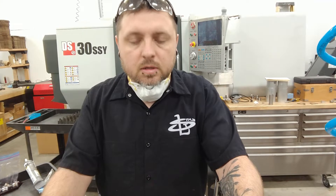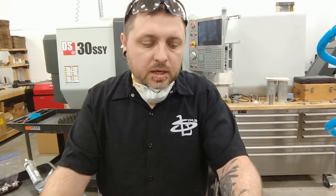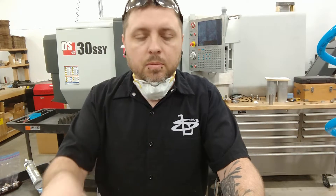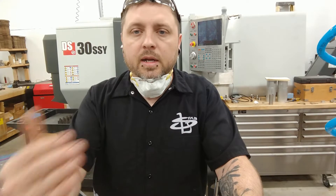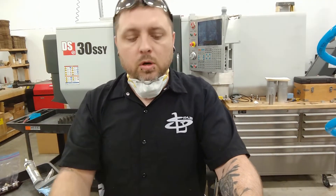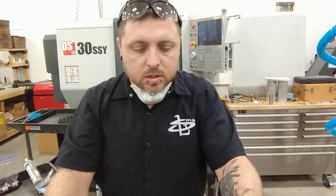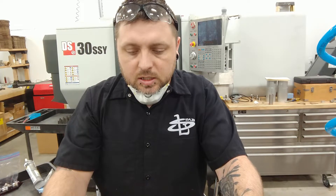Make things transition well, make things flow well, and pay attention to some of the spots that might not be so obvious. A lot of people work on the bowl shape right behind the valve, but what's funny is that the inside radius — the radius that cuts back from the valve on the bottom of the port — is actually more important than the outside radius, which is kind of counterintuitive.